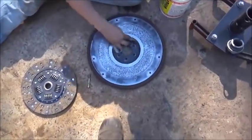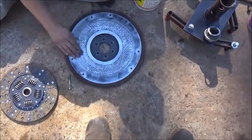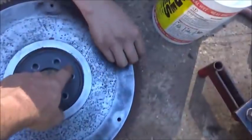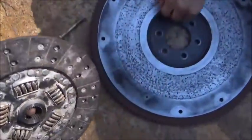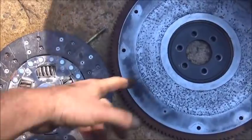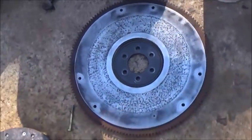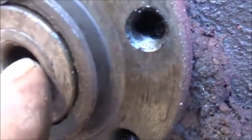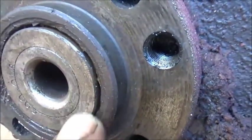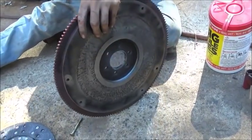Hey folks, Jonathan here working on the flywheel, getting ready to put it back on the engine. Had to do a little machining here — had to open it up a little bit around the outside so it wouldn't hit any spring, and we also had to shorten the hub up just a little bit so it wouldn't stick in too far and hit the pilot bushing. As for the pilot bushing, that's done — it's a Chevrolet bushing pressed into the Ford bushing. I machined the Ford bushing out, which will fit the Chevrolet, so if I have to replace it I just put another Chevrolet back in there.